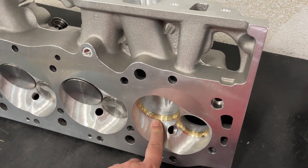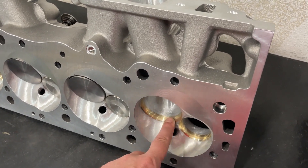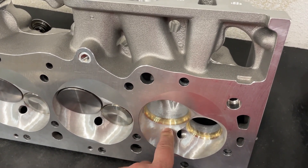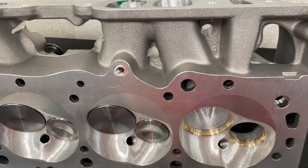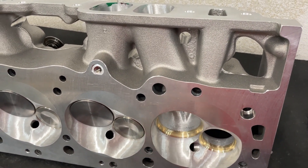On the intake side, usually I put a 55-degree valve job. This one is 50 for the same reason as the exhaust. When you order the heads on the intake side, they usually have a cast iron or ductile iron seat. This one has been replaced with the same material as the exhaust seat — and you might ask why. Because those are titanium valves. These are coated, so they could run on the ductile iron if you want, but I feel better about having them on those. So that's another option.